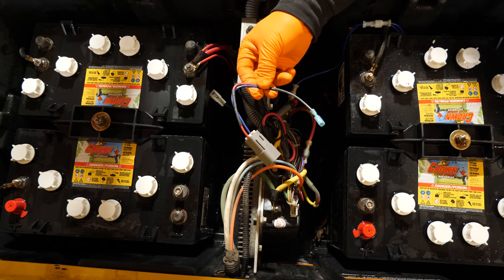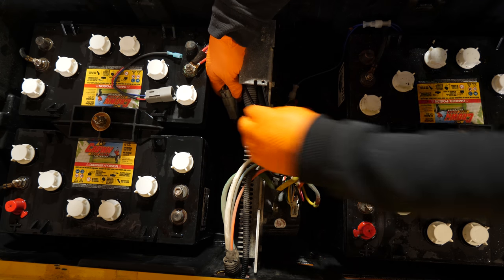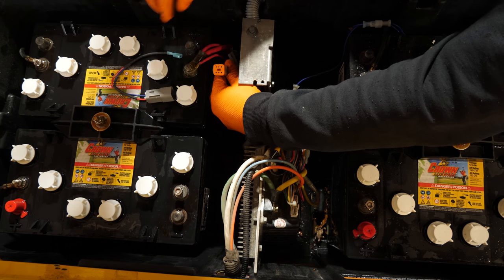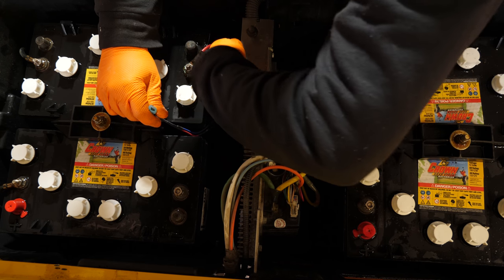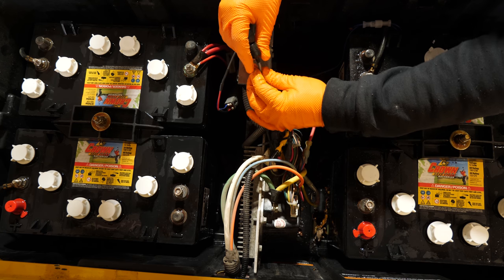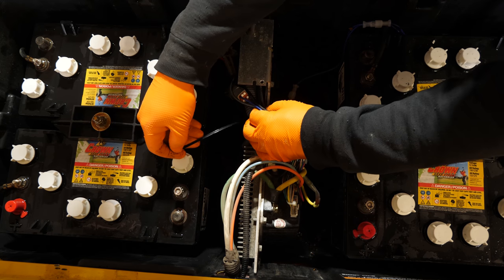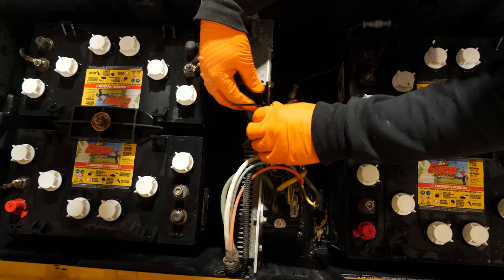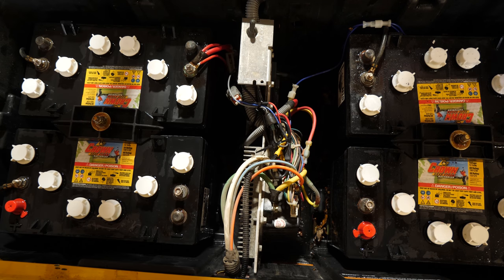The next connector is wire assembly A, which has the same gray connector down in there. Unplug it from the onboard computer, and from the cart harness — you can tell this is the cart harness, it has the yellow or orange piece in there. Then plug this in, unplug the gray connector from the onboard computer that has the rubber cover on it, and this also goes to the charger socket — plugs right into that connector. For cable management we're going to zip tie this here, just to keep it clean so anyone who gets into this compartment in the future will know it's been done.